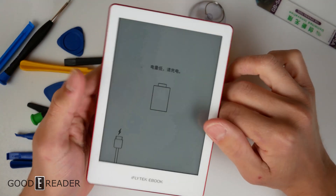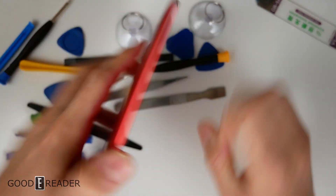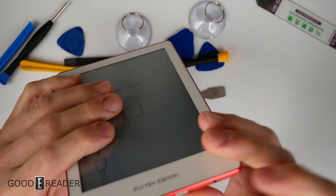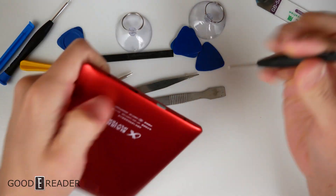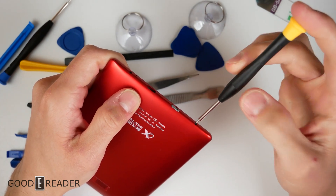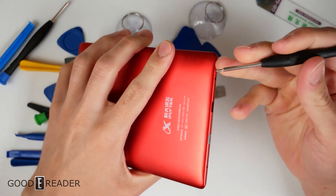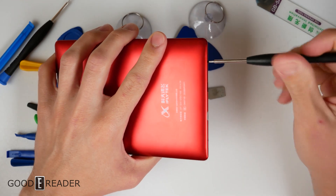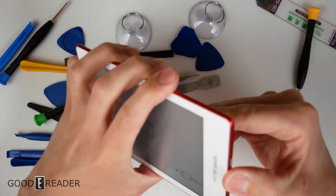This is a flush screen and bezel design — not a sunken screen. Sunken screens would be easier because you'd just reach in and pull it off. This one is a little more sealed up and was never really meant to be opened. We do have some Phillips access screws right here, which are usually there for servicing — things like changing the USB port, resoldering or swapping the battery.